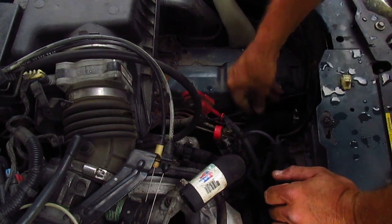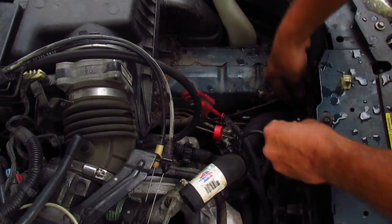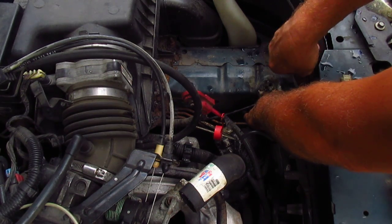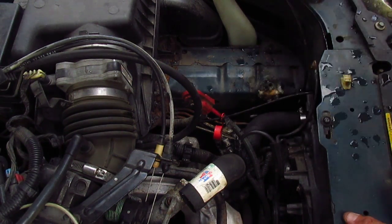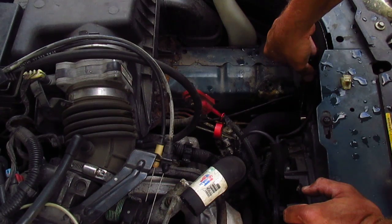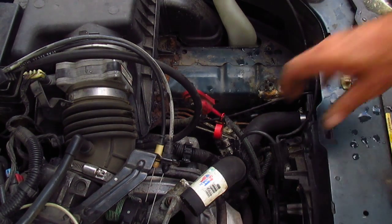Now I had this new hose in my car because this car's got a lot of miles — you never know what's going to go wrong. This is a little quarter inch nut driver. Never try to mess with these things with a screwdriver, you're driving yourself crazy. Slide it on, and see how I can just put the nut driver down in there. In the future when I have to get this off, I probably won't even have to take the battery tray off. You want to make sure the clamp is behind the flange, not over it, and tighten the clamp so it's basically flush with the hose. Don't over-tighten it — you don't want to damage the hose.